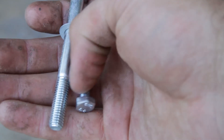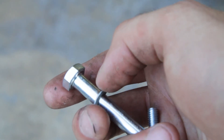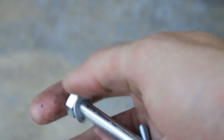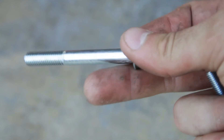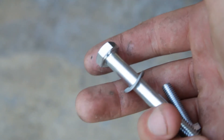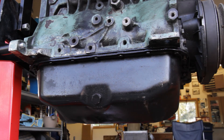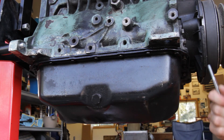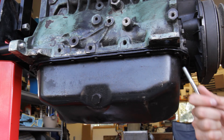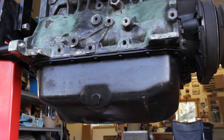So here we have an M8x75 and an M6x25. The washer you're seeing right there is actually a spring washer or a wavy washer — I don't know why a lot of hardware stores call them wavy washers, but you can kind of see. You'll need two of the M8 75s and 20 of the M6 25s. The 25s are a little bit longer than the standard bolt for the oil pan, and you will need them to clear the baffle we put on. So we're going to take these off — these do need to be torqued down to a specific spec, so we'll talk about that in a minute.